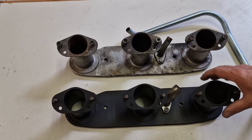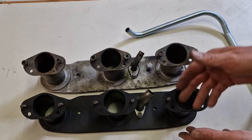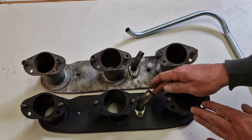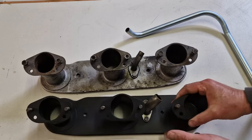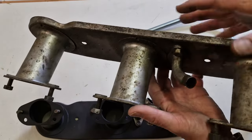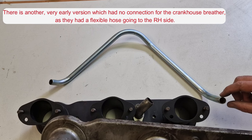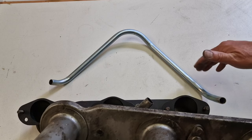And here's another thing I wanted to show, which can easily be confused. Now here they're different, that is black and that is primed, but basically they look the same. You notice that this is the crankshaft breather exhaust, which goes back into the air intake. This is the thinner one, and that is the early one, you see, and this is the breather. This is the breather hose part, which is coming out at the cylinder head at the front, and is going down, passing between the distributor